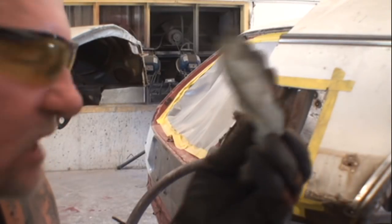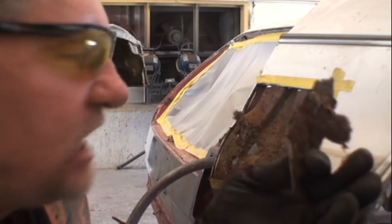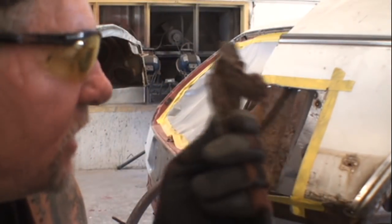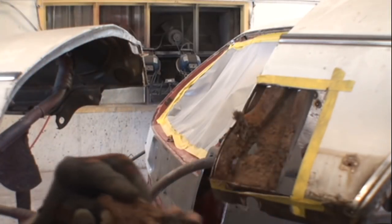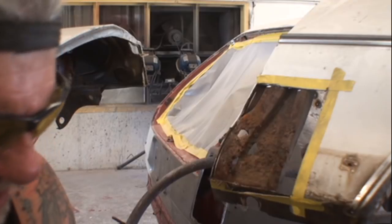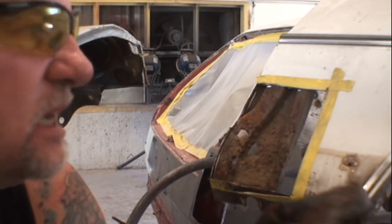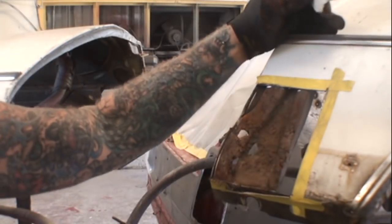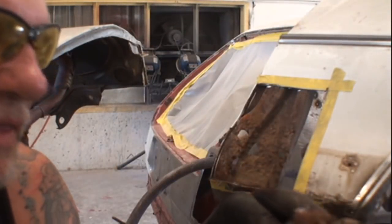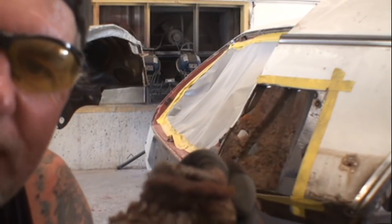This is one way you can fix rust if you're just doing a quick paint job and can't afford expensive repairs. The steel wool and Bondo method — they stuffed it in there and smashed the Bondo on top, basically. Doing my investigation, I'd say this was probably done in the early to mid 1980s. The car has probably never been repainted — this appears to be the original color, though this fender may have been repainted. That lasted a very long time, so it's a valid approach.